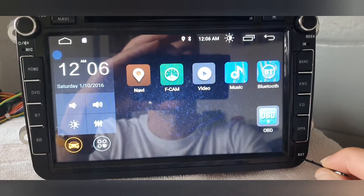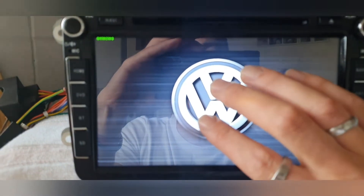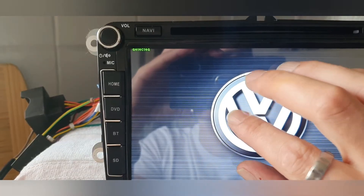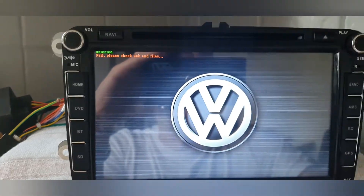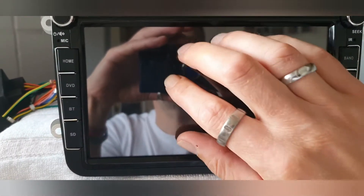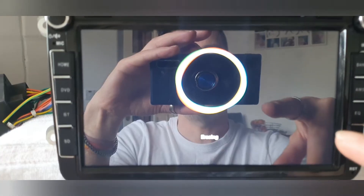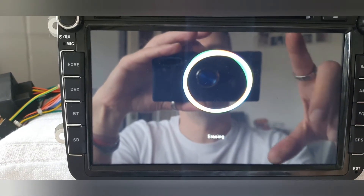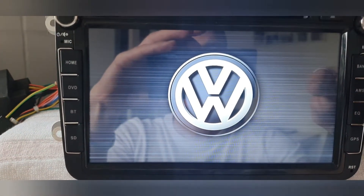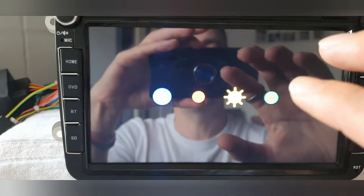What I discovered out of frustration is: if you hit the reset button, then as soon as it starts booting up, tap the screen with five fingers. This sends it into recovery and erases everything on the head unit — a full factory reset. So if you want to do a factory reset on a head unit that hasn't got a physical factory reset button like you get on some tablets, hit reset and tap five fingers on the screen.